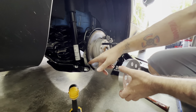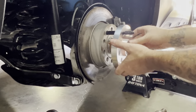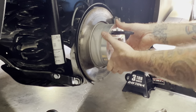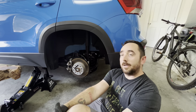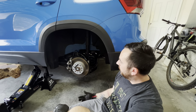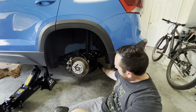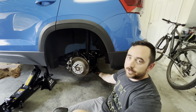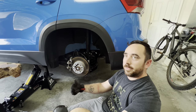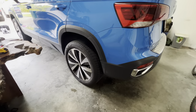Don't forget to put the shield back on. Then throw the 20mm spacer on. On the other side it's already up on the jack with a jack stand for safety. Get the two 18mm bolts and the 13mm out, take off the shield, reverse the process, put everything back in, and that side is done.